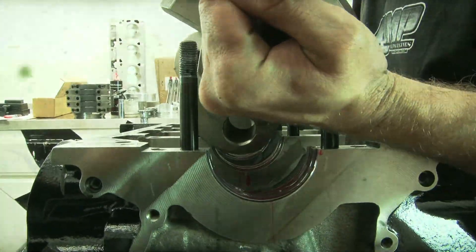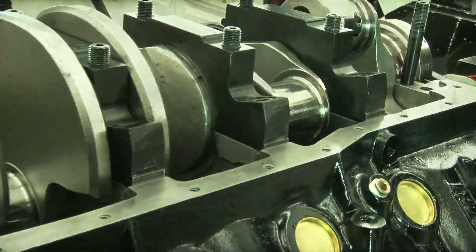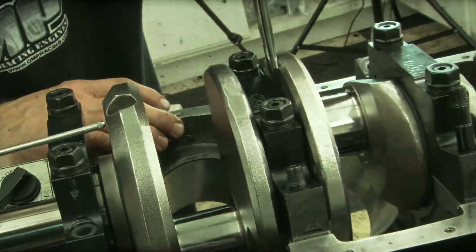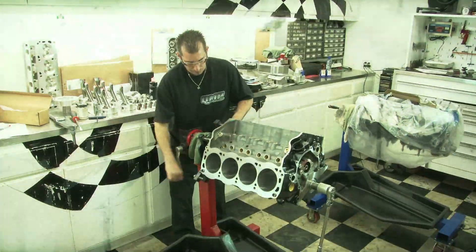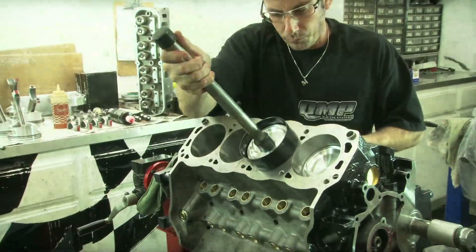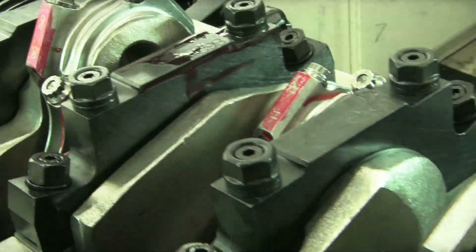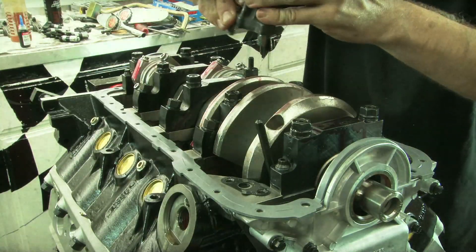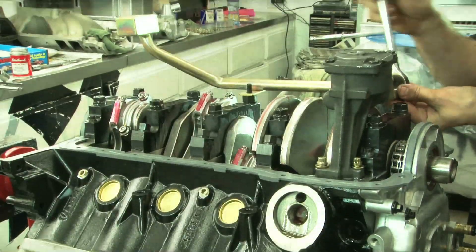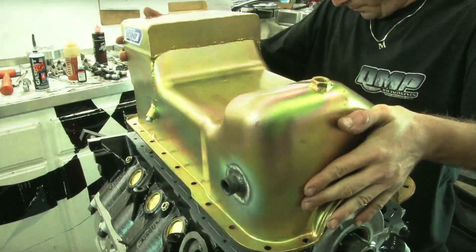The main bearings were installed on the crank bores and main caps. QMP secured the forged Eagle crank with the ARP main stud kit specifically designed for Dart iron blocks, then checked for proper end play before the nuts were completely torqued. With the engine right side up, QMP fit the rod bearings and began sliding each hung Ross piston and Eagle rod into the bores, attaching them to the Eagle crank. With the short block nearly buttoned up, QMP installed the Melling oil pump and one-piece drive shaft. Attached to the oil pump is the Canton seven-quart capacity front sump oil pan with an integrated crank scraper and slosh baffle.